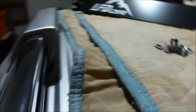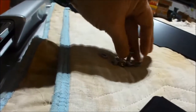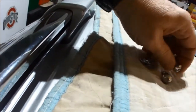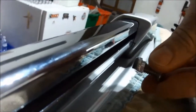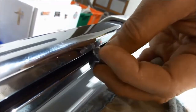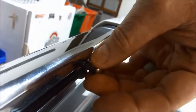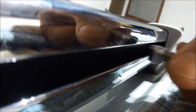Let me spin around so you can see the groove inside the factory rail. That groove is going to take one of these bolts. They warned: whatever you do, don't drop this in there — if you do, you're going to have a hell of a time getting it out. So put a couple of spins on this to make sure it's in there. What it's going to do is go into the groove, turn sideways, and then hold it into place. See how it turns sideways and now it's held in place?